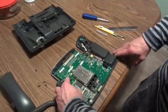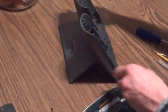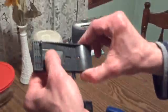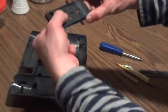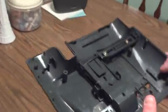When you put the screws back in, you want to make sure you don't over-tighten the screws because these posts are plastic, and if you tighten them too much they will break. Another thing that goes wrong with these phones is that sometimes they don't want to stand up. If they keep wanting to fall down on their own, usually this part breaks. If you have another phone, you can just take this part out of it and put it back in. There's a middle part that breaks — just grab that, stick it in there, and you're good.